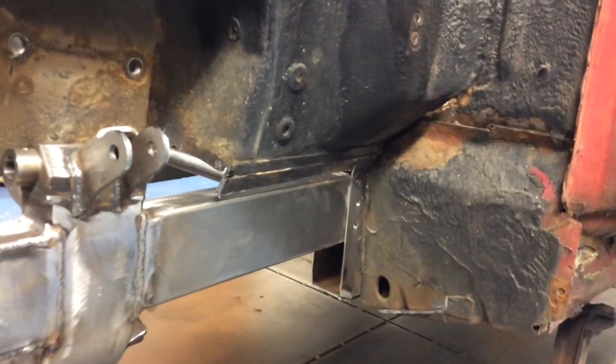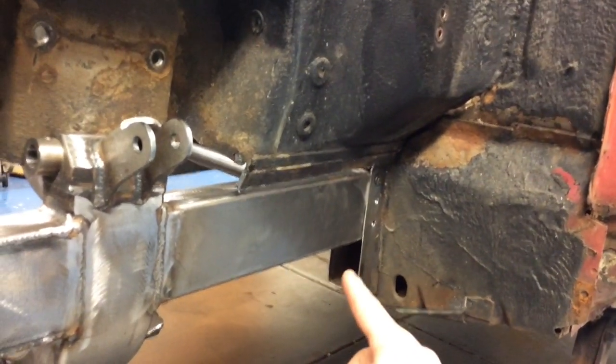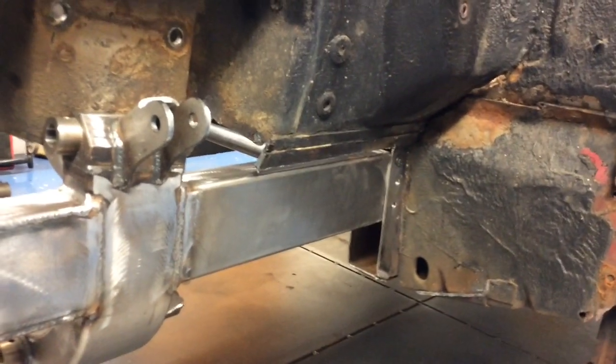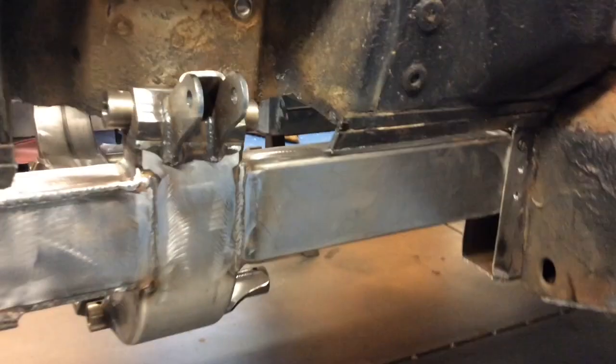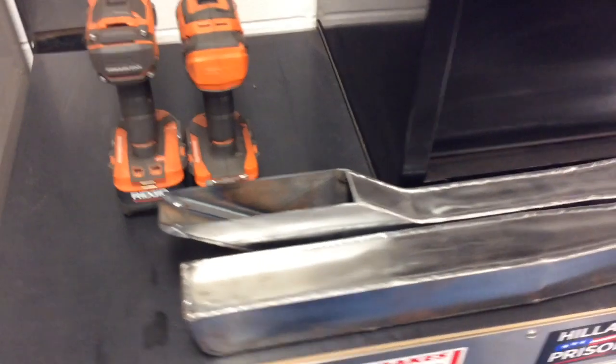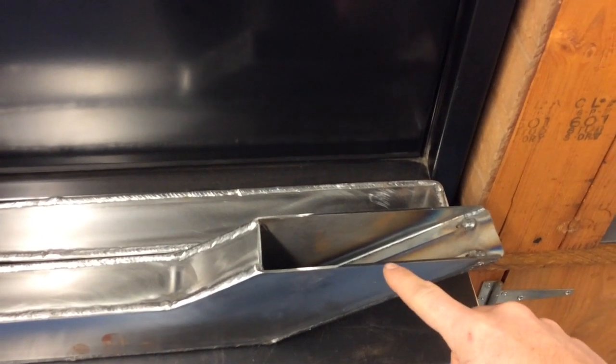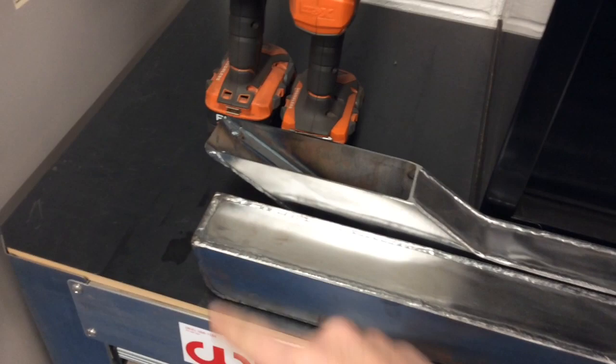where they're tight on the top side, because there's a plate that they make that attaches to the bottom of the rail and then goes back the whole way up the floor support. It connects to part of the original floor support, and it basically is a new floor support, which are these pieces here. So this end will get welded up in place and then go back to the end, and that's going to be your new end of the floor support on the very end of it.